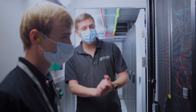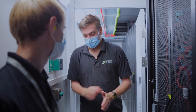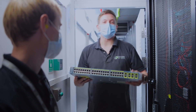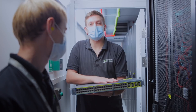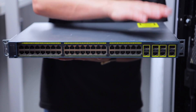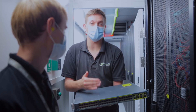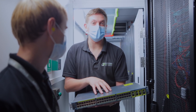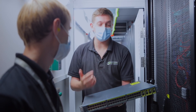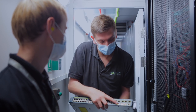We've got a red and a green cable which connect back to the core routers. We're going to mount two switches here — the switches we're installing today are two Cisco 2960Gs. These are 48-port switches and they're fully gigabit capable, meaning every port can output and receive one gigabit per second. We're using these because they're cost-effective, they do the job — literally just switching at one gig.